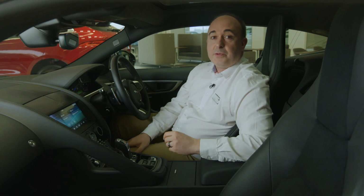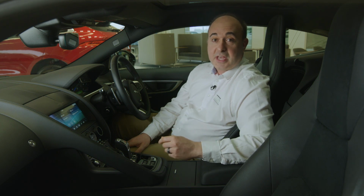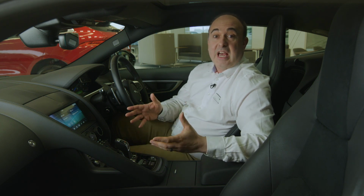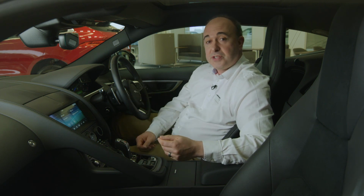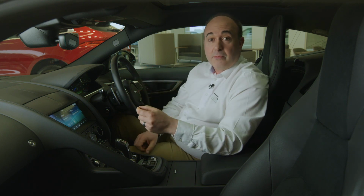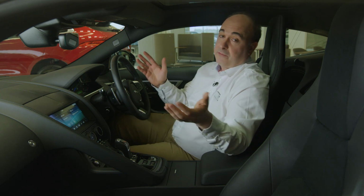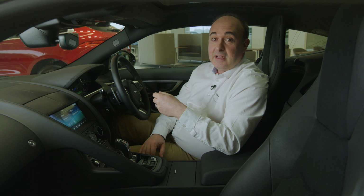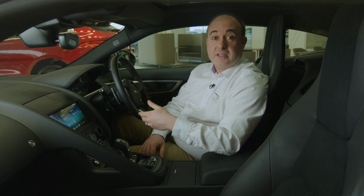All cars are fitted with exhaust filters. These need to refresh occasionally and you may notice more visible exhaust emissions while this is happening. On a petrol engine, it happens more frequently when you lift off the throttle and more oxygen passes through the system. Now occasionally, the car may display a message saying drive to clear. This is most common on petrols when they've been used under load, like towing. It's not for me to judge how you use your F-Type. Find occasions to lift off the throttle and slow using engine braking to clear the filter.